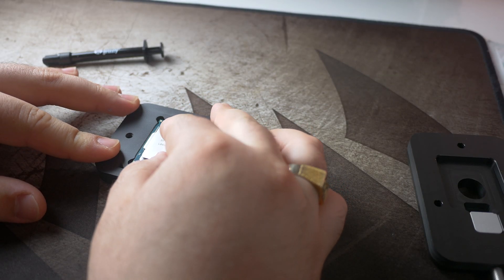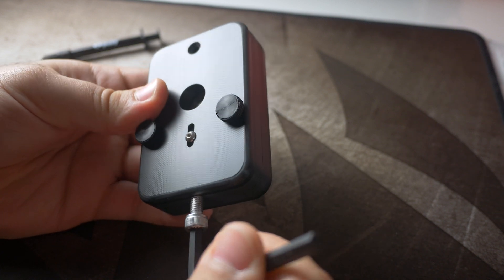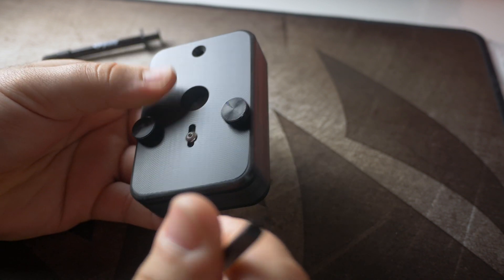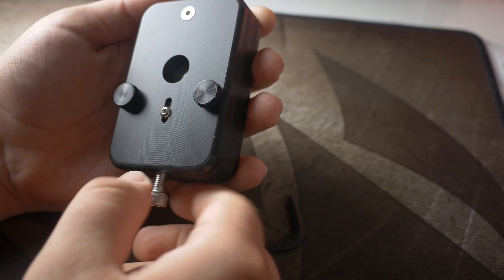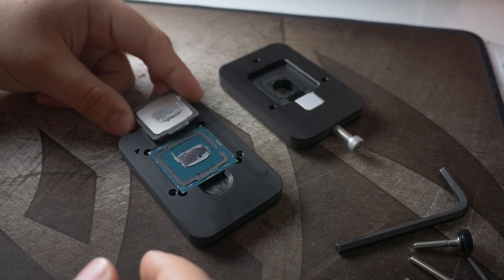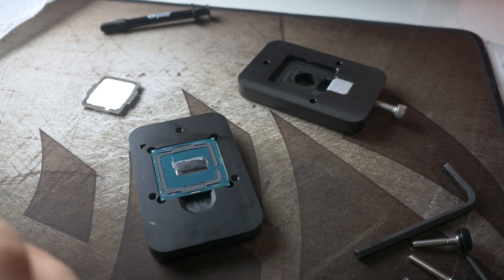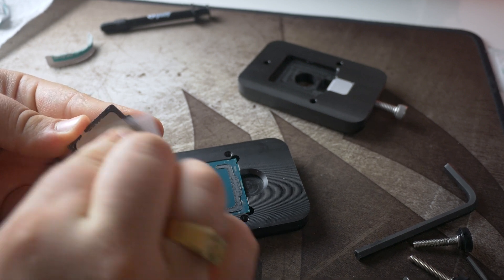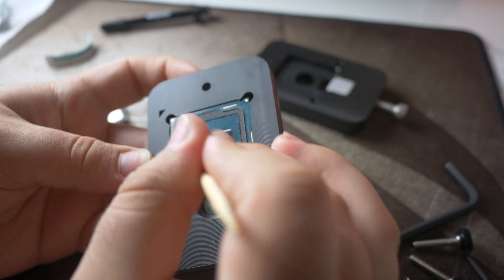The process is as simple as inserting your CPU into the slot in the tool and tightening down the screw. It pushes a little platform that applies pressure from the side of the IHS, which eventually frees up the adhesive keeping the IHS glued to the CPU. Once the IHS is freed up, loosen the screws and remove both the CPU and the IHS as they now need to be cleaned. You can easily take the big chunks of thermal paste off with a clean paper towel and finish cleaning both surfaces using isopropyl alcohol. Make sure you get all of the old thermal paste off.